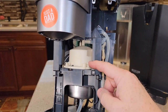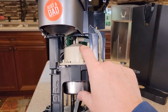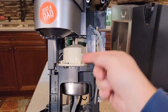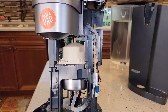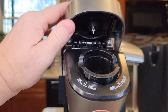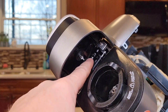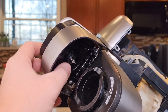The K-Elite is one of the loudest Keurig machines — that's just the water; it's boiling the water inside here and it'll be ready to brew. Water does stay in that tank even after you do your brew, so it's good that we descale these. Up here where the needle basket is, I don't recommend taking any of this apart — it's a bag of worms up here. There are some screws, but I don't recommend it. There's the needle; I've got a video on how to clean that with a paper clip.